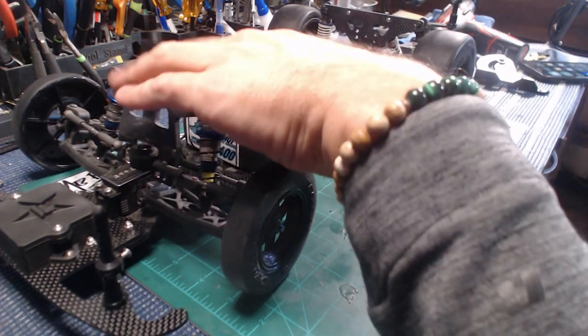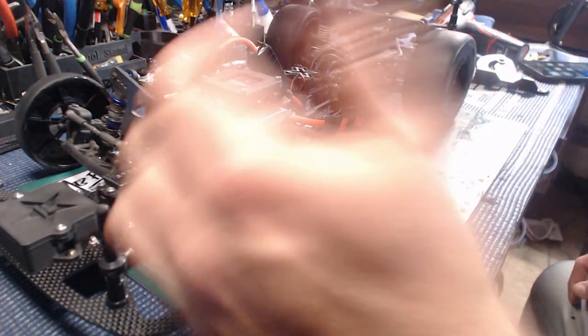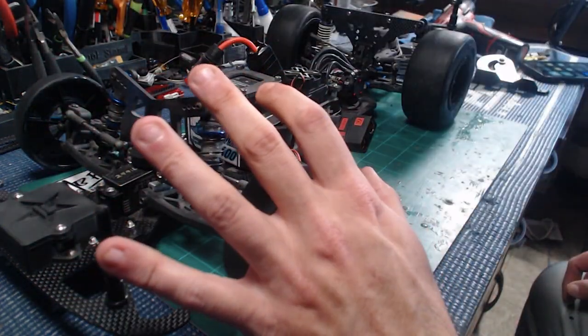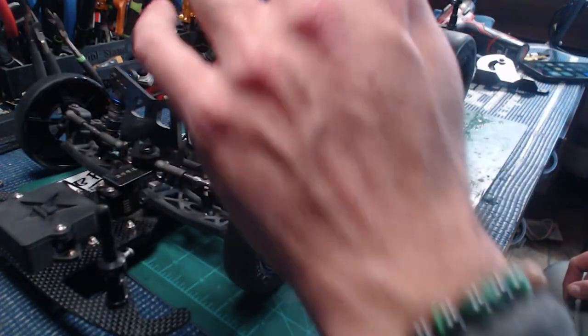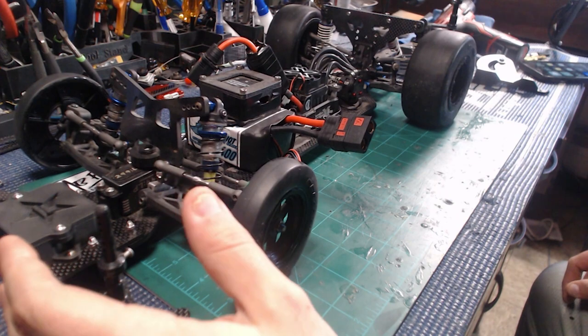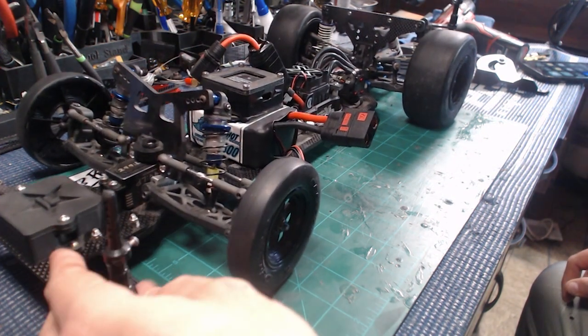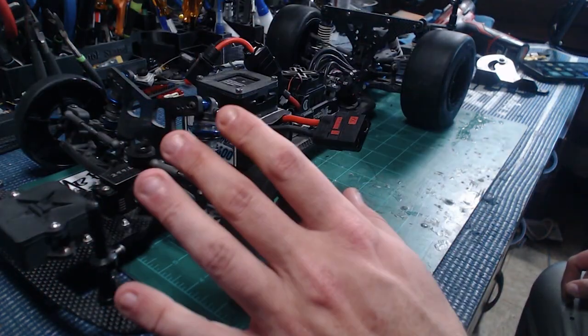If we look at the front of my car and try to push down on it, you're going to see that I can't really go down a whole lot — I'm already settled in there pretty good. The whole reason behind that is I have the whole front end limited to about a quarter inch, which is the MPRC rules, because you do not want a lot of movement up here at all. I think this is one of the biggest things to my success — when you have so much lateral movement in here, you are unable to get yourself out of bad situations.